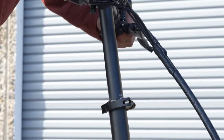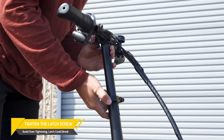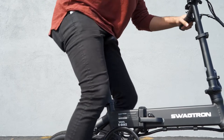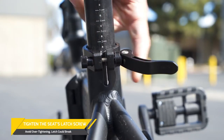Because the EB-5 is so foldable, clamps can get loose over time. Tightening the latches is easy, but tighten just enough to offer some resistance when clamping. Seat post clamps work the same way as the stem clamp, so be prepared to adjust when needed. Too much and it will not clasp properly.